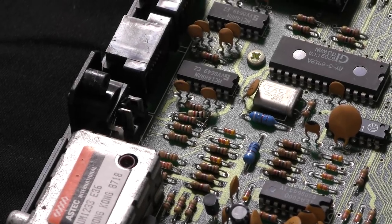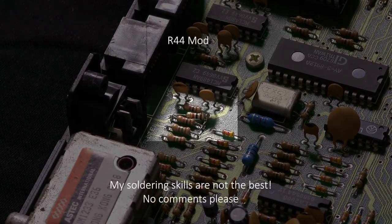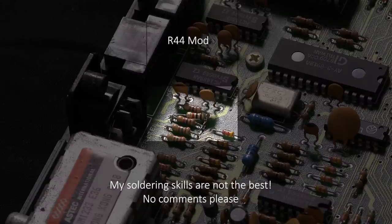There's a quick fix you can do with a basic soldering iron — that's the R44 mod. This involves soldering a 1K quarter-watt resistor across the R44 link, which can fix any ghosting issues when using a SCART lead, and in some cases force the TV to switch to SCART RGB mode. It's worth doing if you're poking about on the motherboard with a soldering iron.